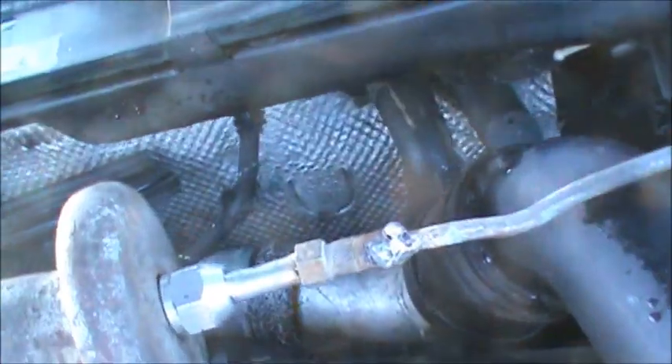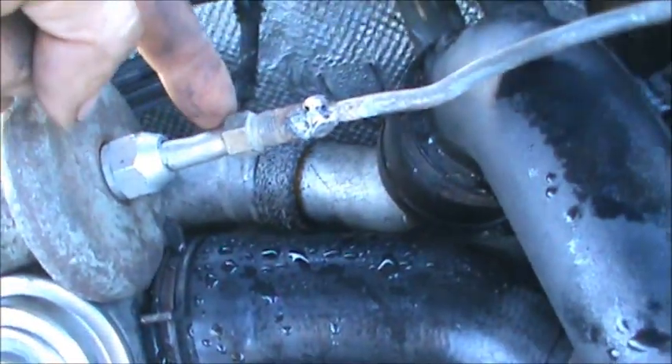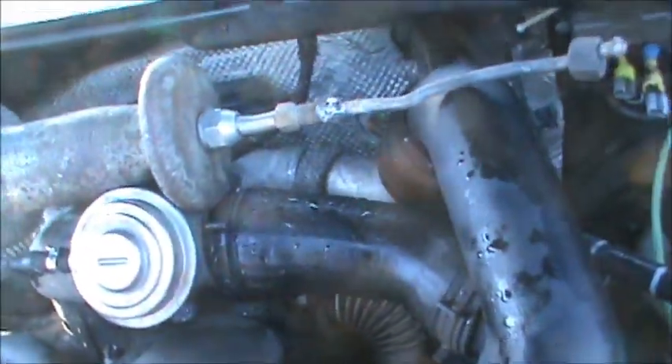We'll test this slide hammer with the new attachment. What I did was took an old slide hammer, then took a hydraulic fitting and fitted it on there, and welded it onto an old injector line I got from an auto wrecker. They had someone cut all the injector lines to get the injection pump or something once upon a time. So I grabbed that, welded it on, and now I've got an attachment. The injectors seemed to come out pretty good — I've only tested it once and it worked really well.